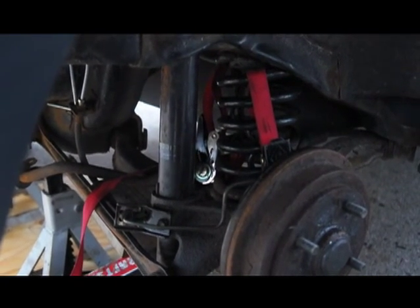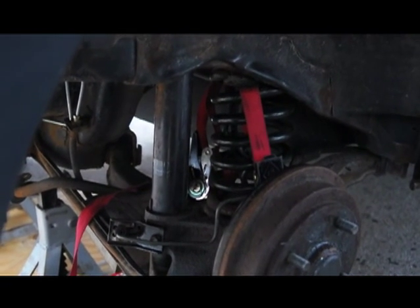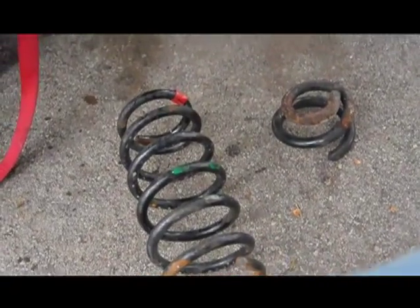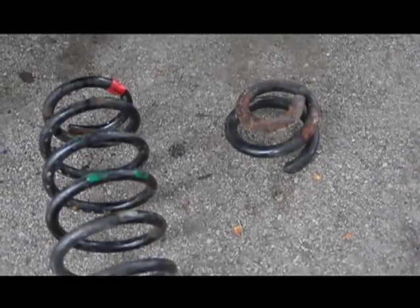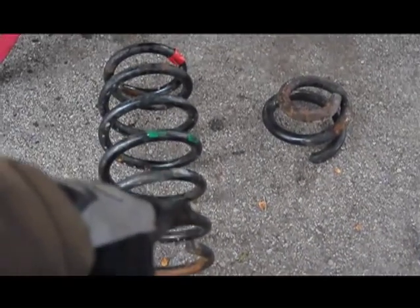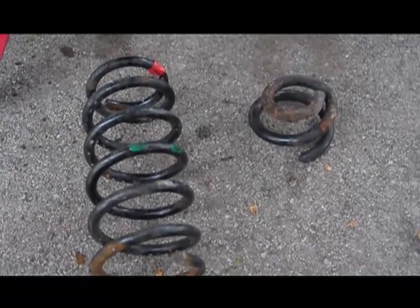This is the right rear wheel of my electric GeoMetro. In there right now you can see a Ford Ranger front coil spring compressed down with two ratchet straps. Here on the left is the original GeoMetro spring, and on the right this is about two coils worth that I cut off the Ford Ranger spring to make it the same length as the GeoMetro spring. But since the Ranger spring is a thicker material, it can hold a lot more weight for the same size.